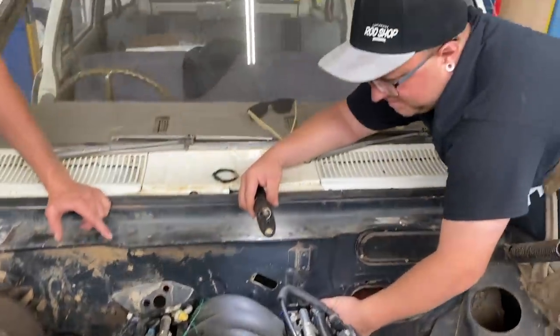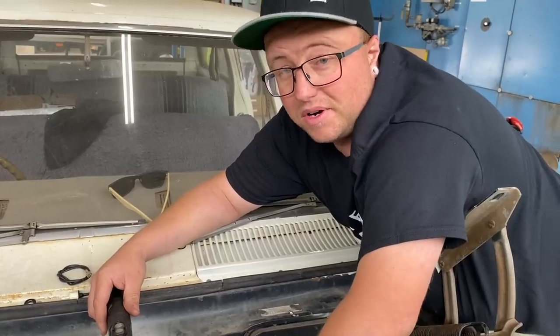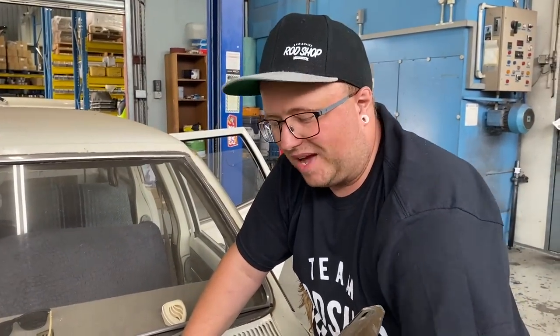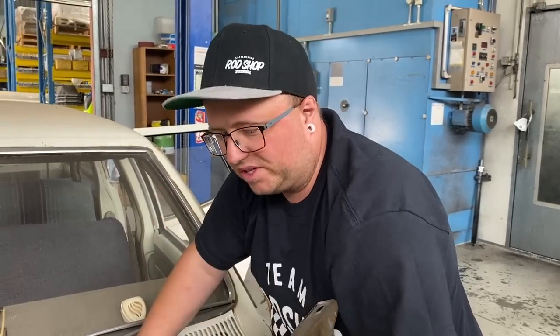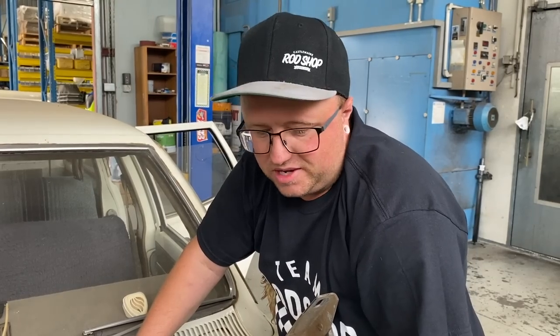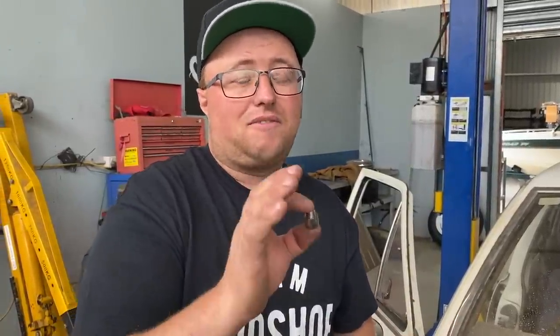We'll finish it all out in the engine bay first, then put the alternator in and wire it back up, then tidy up all the wiring in the front of the engine. Because we've gone for the LS2 with the smart alternator, you do need to run the smart alternator. But if you still want to run the alternator warning light on the dash, you can put an LS1 alternator on there, which will sit in the right location. Because we're fitting aftermarket gauges for oil and temperature, we have a temperature sender adapter and an oil pressure sender adapter. These allow us to run the original factory LS senders for the ECU as well as aftermarket gauges on the dash.